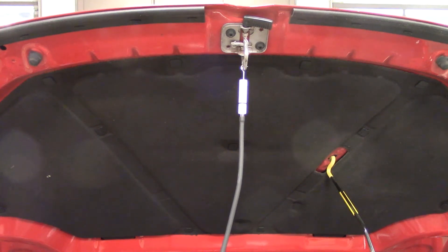I have this hooked up. I'm going to attach this to the high side and bring the flow meter up closer to the camera so you can see. What we're looking for — car off — is after about three minutes we want to see just about the same flow rate. If the flow rate drops below 30% of where it was, we have sealant in the system and we'll need to break the system down, flush it out, and maybe even replace some components before we hook our machinery up.